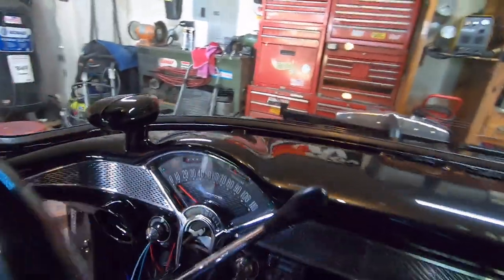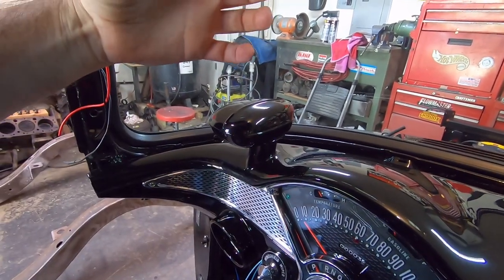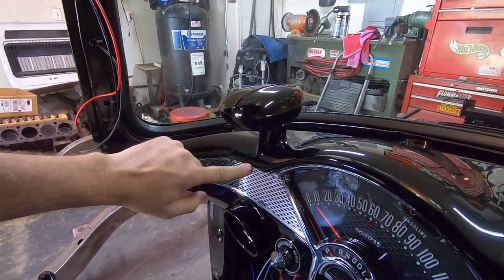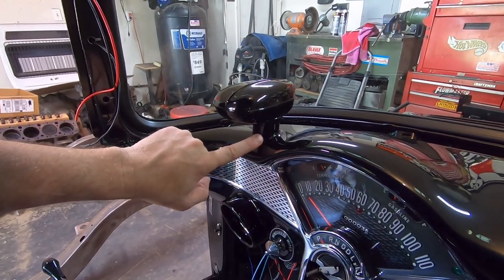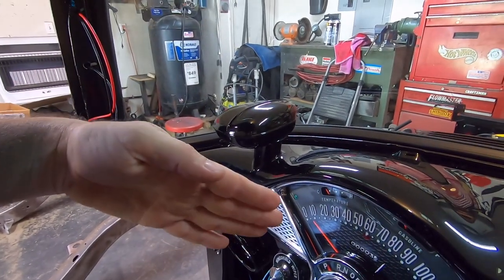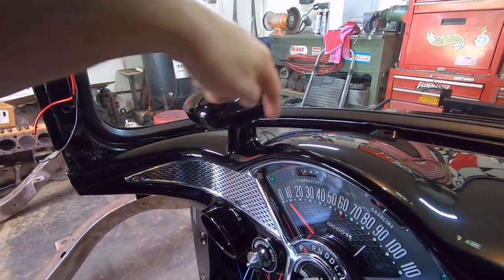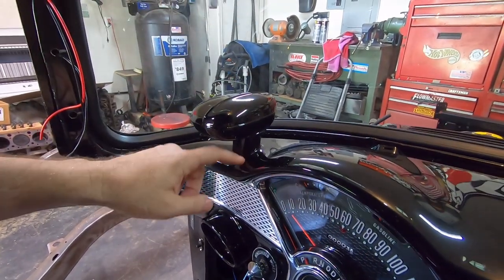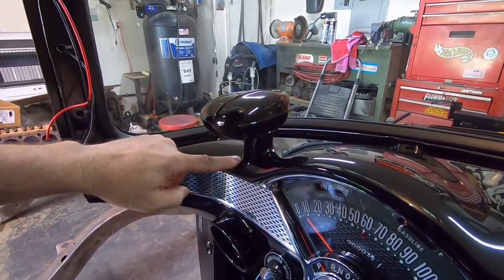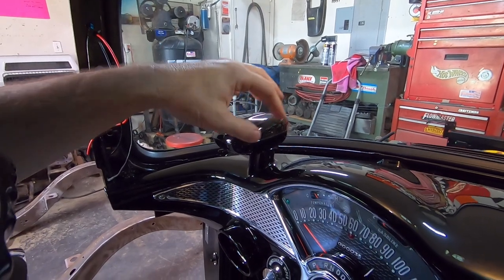I did it just like original because the bottom of that Autotronic Eye has a pocket up inside that's teardrop-shaped, so I had to build this exactly to fit up in there like factory. I ended up using a piece of muffler pipe — I stepped on it on the ground to oval it, then split one side with a cutoff wheel, squeezed it together, and welded it. That's how I got my teardrop shape. I set it up here, traced around it, cut the dash out with a fine-blade jigsaw, sunk that piece down in, and welded and molded it all the way around.